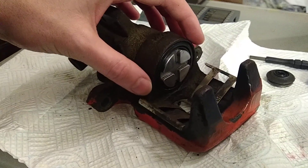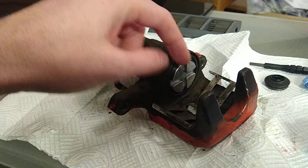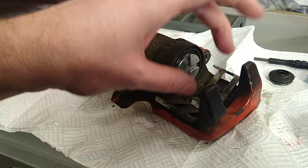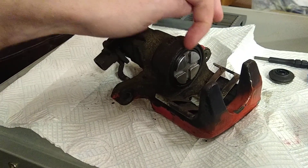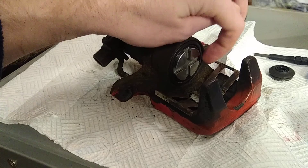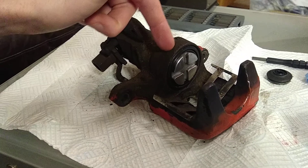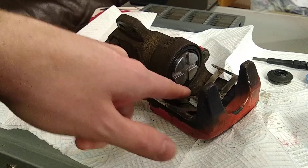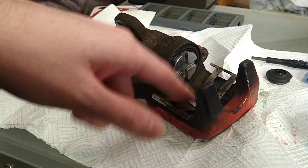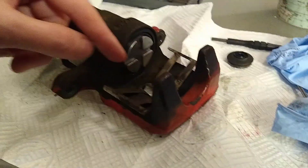So there are two theories when doing it solo. One is that you put the boot on the piston first, kind of hanging off the back edge of the piston, then put that whole assembly carefully into position. In theory you'd go around and try to push the seal into the groove in the caliper housing. But trying to do that, it keeps popping out, and you can't even get all the way around the back because of the shape of the caliper — there's not a big hole through here. So I couldn't do it that way.